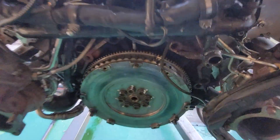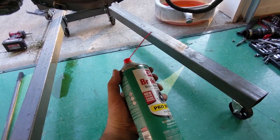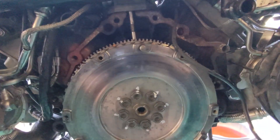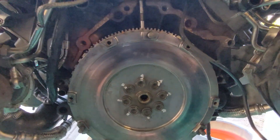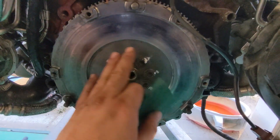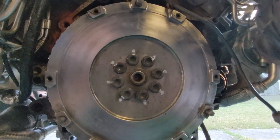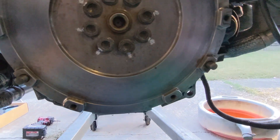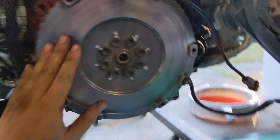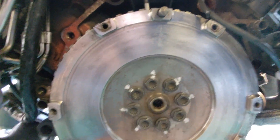One other thing we're going to do to this flywheel as well as the pressure plate surface is hit it with some brake cleaner and wipe off any machining oil on the pressure plate. We're going to hit this flywheel and give it a quick scrub with some Scotch-Brite just to clean up the surface, get rid of anything that might have glazed over from the clutch slipping. We don't have to get it mint perfect, but we do want to address anything left over from the previous clutch after it failed.